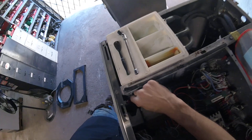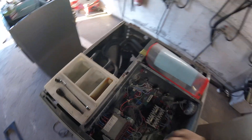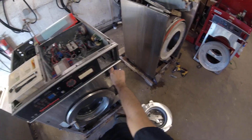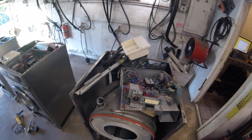You also have to unplug the wires for the on and bleach light, and then lift the timer out of the way. With this off, you have to pivot the control tray to get it off of a bolt here. Then you can lift it towards the back of the machine. I use a block of wood just to help hold this up out of your way and expose it.